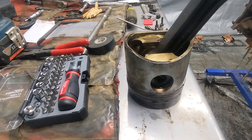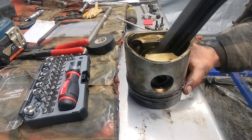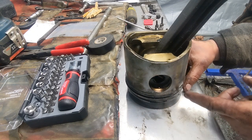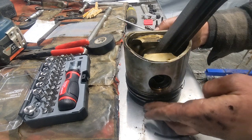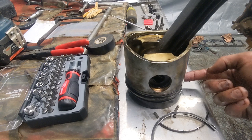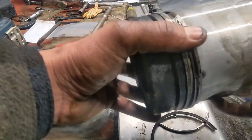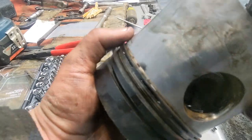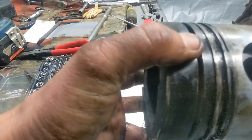Alright, so the pistons pushed right out the top of the block, no problem - really easy. Now when I was looking at the top of those sleeves, I was thinking that some of the wear I was seeing on the top of the piston was an indication of ring failure. See, this one is still good, and these are one-piece rings. Well, this one here is supposed to be one-piece as well, but as you can see it is multiple pieces - they're broken. They're all a little bit different the way they're broken, but every single one of them - that ring on the top side of the piston - is broken.